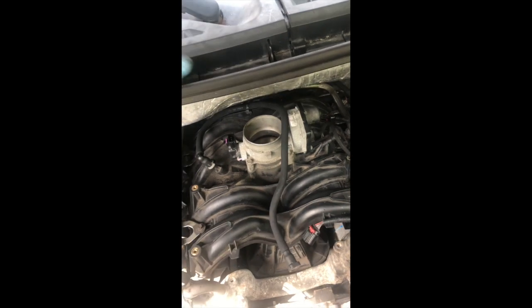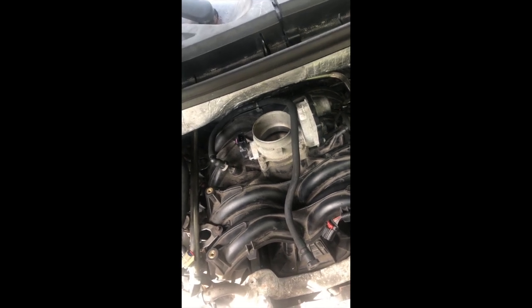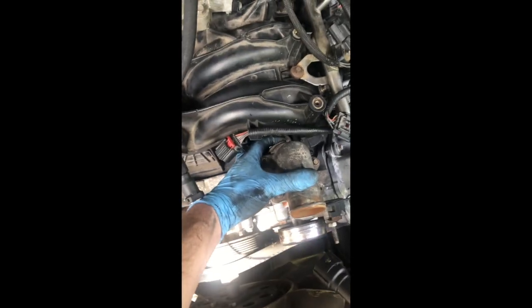There's also going to be a nut on the back of the air intake that you need to get off — try to make sure you're still holding on to it when you remove it, because that holds the engine harness to the intake manifold. Once we've got this loose, we can kind of lift up — that'll allow you to get to this bolt right back here. You really only need to pull off this bolt back here and this one right up here in the front, and you should be able to get that off. You really don't need to take this head off.